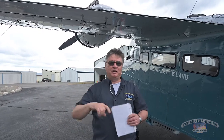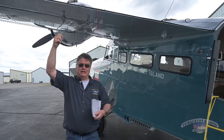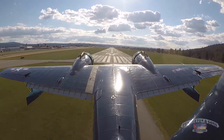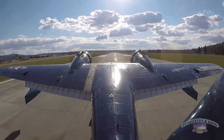The wonderful thing about that system is like your old Ford vacuum windshield wipers going uphill on a rainy day. On a go-around, when you nail the power, you start to lose some vacuum pressure. Aerodynamically, the flaps will fly up a bit, which prevents them from being damaged, and at some point they'll fully retract kind of slowly. So the danger of exceeding VFE or over-flap extension speed is pretty minimal in this airplane. In landing, you select flaps 30 then flaps 60 — you don't get full 60 degrees until you're kind of in the flare. We come over the fence at about 90 and roll it on in the high 70s.